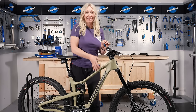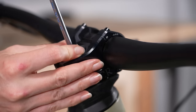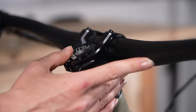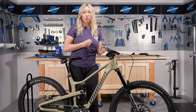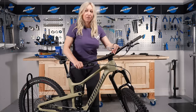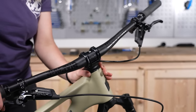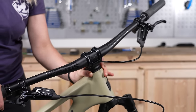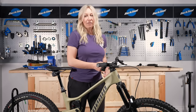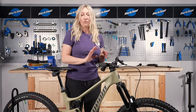The really important part is reassembling in the right order. Start with the top cap, as this clamps the forks, headset, and the front of the bike together. Do this by hand until you get a little bit of resistance — you don't want to push it too far as you could pull the nut out from inside the steerer tube. Once you feel that little bit of resistance, apply the front brake and rock your bike forwards and backwards to make sure there's no wobbling or knocking in the headset. Then tighten up the stem bolts to the torque spec stated on your stem or in the manual.